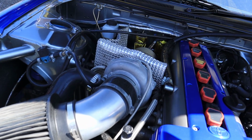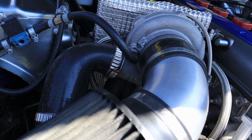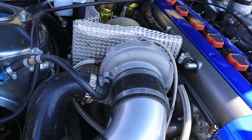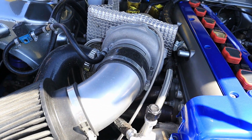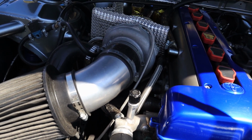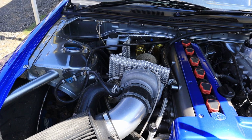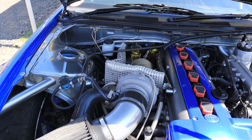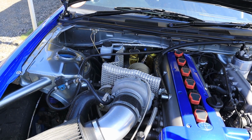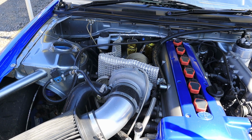And the turbo for 700 horsepower doesn't look physically that massive. No, it is maxed out. It's a Garrett GTX3076 Gen 2. It surprises a lot of people that it makes the power, but the reason we got this set up, it's got an 0.82 housing, is the boost response. So I have full 1.7 bar boost at 2,700 RPM. It has everything at that point. Makes it much easier to drive. Oh yeah, absolutely. You're not kicking the life out of the car as well.